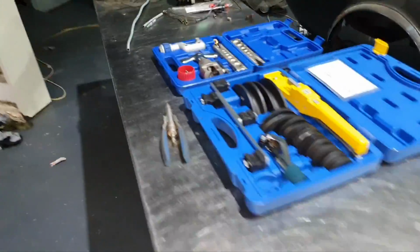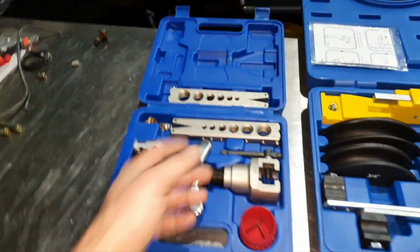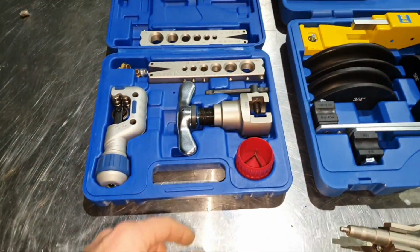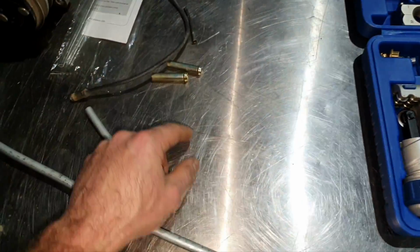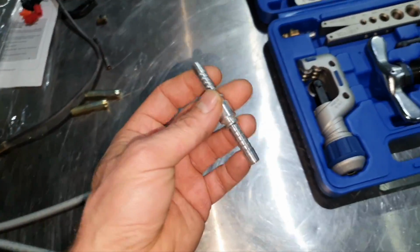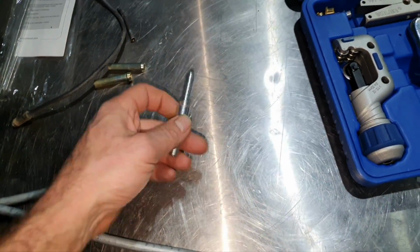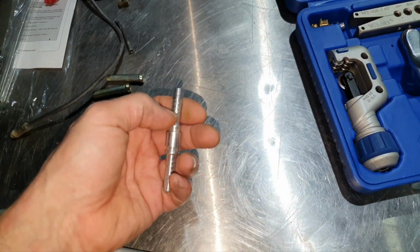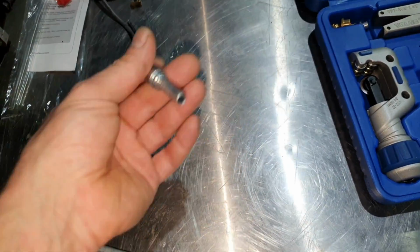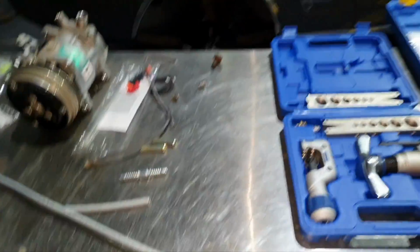So, yeah, with the same tool I bent the main fuel line down, and this one is the one that's expanding. I think that I saw you earlier. Okay, the stainless steel T looks like this one, and we're going to enter inside. You're not going to see it, you're going to see only the fitting. It's not going to look like that. I'm going to machine this one, not the specific one. I need the same as this, but a T, coming like that. Now, let's finish the video here.